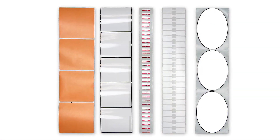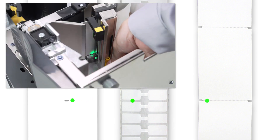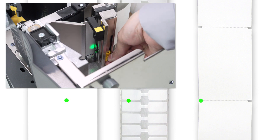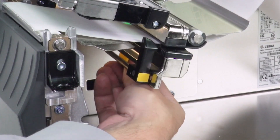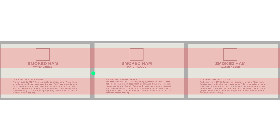If you're using media with a gap, also referred to as a web or a hole or a notch, make sure your sensor is in the optimal position to identify that feature. Move the sensor to a location where the light passes through the notch or hole, and try to avoid locating the sensor under the hole or notch radius. If your media is not a simple rectangle, such as a circular shape, locate the sensor over the leading part of the label. If you're using media with print on the other side, try to locate the sensor away from the print so the sensor does not get a false reading.